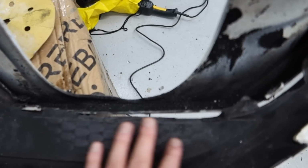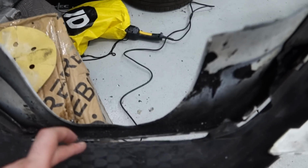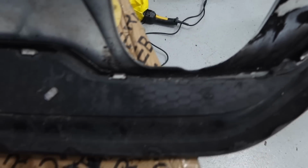Plastic. So what we're going to do is we're going to be scotching down, what's it called now? We should be sanding down all the area. We will be applying the plastic mesh and weld as well. So yeah guys, next thing to do is basically sand all this area down, get it ready for the mesh and the plastic weld as well.